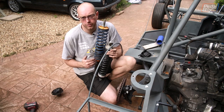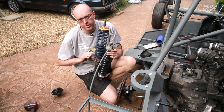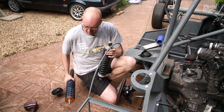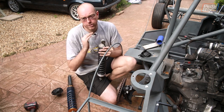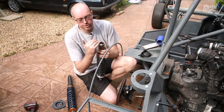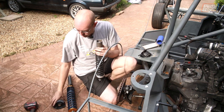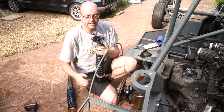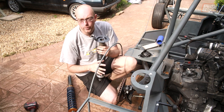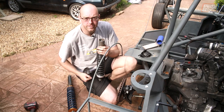You can see the difference between the shocks in overall length - it's about four inches top mount to top mount, but we lose at least two to two and a half inches when the spring completely compresses down on the car, so that's not too much of a problem. To get back the other two inches I'm going to add a little tube on the top as a temporary measure to lower the point from above the top mount to below it, and run the top mount upside down as a temporary test to give about another half inch push down. Then I'll fit it on the car and see where it settles.